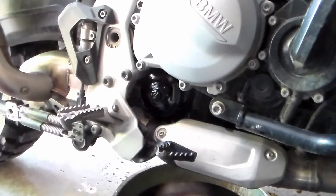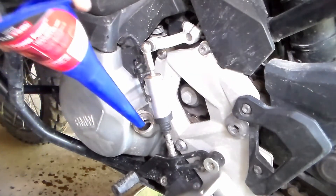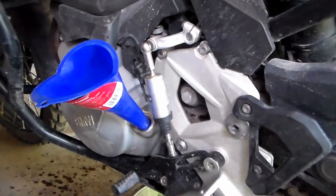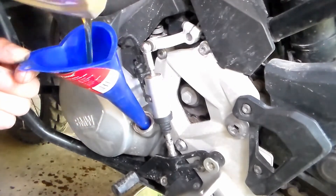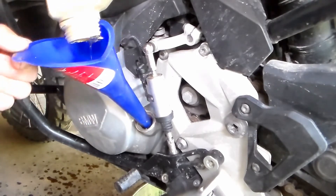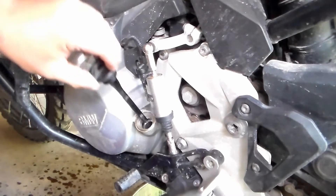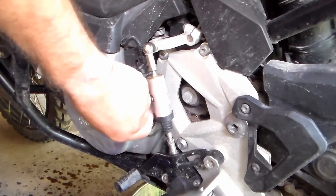Now we're ready to fill this up with some nice clean oil — let's go to the other side of the bike. Right here is our oil fill and dipstick, right above your shifter pedal, so go ahead and remove that. Get yourself a funnel. We are going to be using 5W40 oil — I personally use the Castrol Power One. It doesn't really matter much what brand you get, but 5W40 is the recommended viscosity. Start off by putting in 3 quarts, then we're going to stop there and get a measurement. Replace the dipstick and start the bike up, letting it run for about 30 seconds just to get oil all throughout the system and into that oil filter, and then we'll get a measurement.